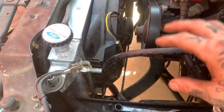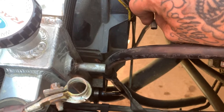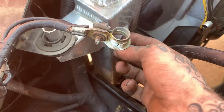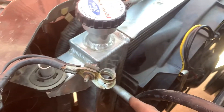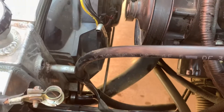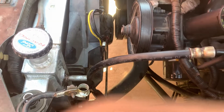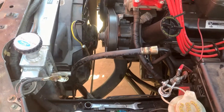To get the top end work started, there's not much work you actually have to do in here other than getting your automatic transmission fluid lines disconnected. I heard you can just take them out and leave them — it's a closed system, so any fluid left in there won't leak out. We'll remove these automatic transmission lines since we won't need them at all going to a T5 manual, which doesn't need cooling lines.